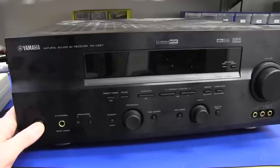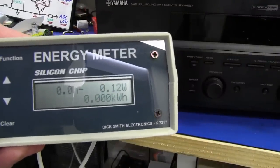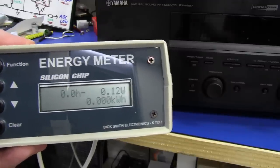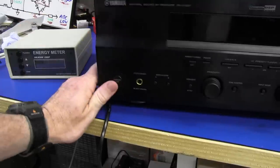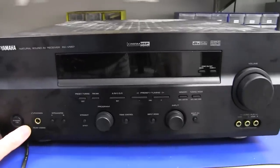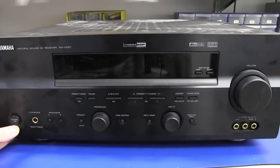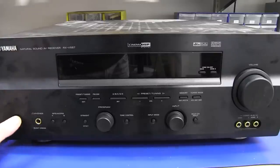It doesn't seem to work. I've got my energy meter here and it's saying it's drawing a standby power of about 0.12 watts, and the manual says about 0.1 watts standby. So clearly it's not the fuse that's gone or anything like that - it's something to do with this soft switch power button. The first thought might be it's a blown cap or something like that, possibly as we've seen in previous videos.